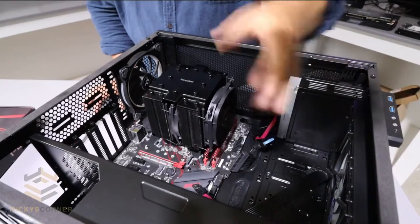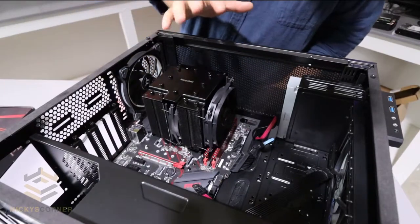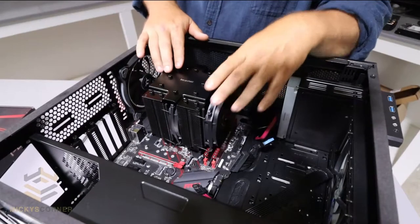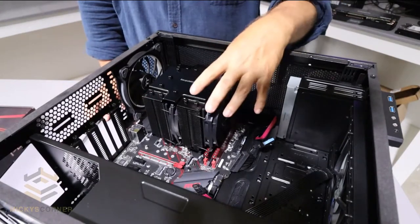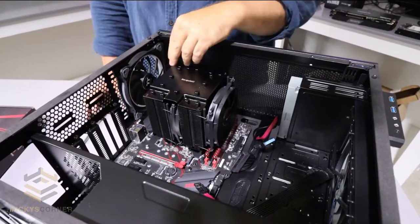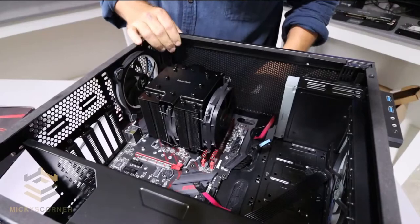I've already put the fans in the front and one in the back — the Thermaltake fans — but we have two that go on the top. Be aware: these fans plug into the motherboard. There's a 4-pin on top of the motherboard right by the CPU, labeled CPU Fan, that will run both these fans off the CPU temperature. Make sure you get those plugged in before you install the motherboard. Also install the CPU power connector before you start putting fans across the top — it's a little bit of a trick. Got it in. Let's get those fans installed.